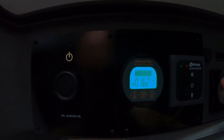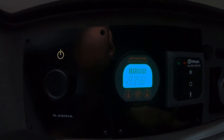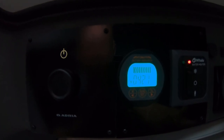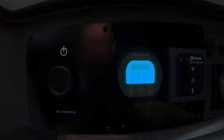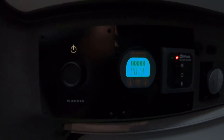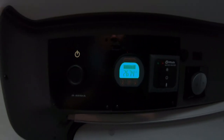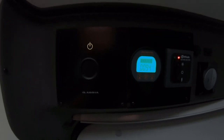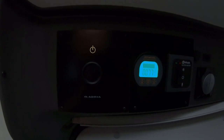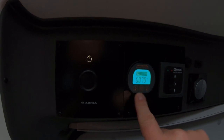If I operate the bed - going up that's pulling eight to nine amps. Going down it doesn't pull much at all - less than 0.6 of an amp. It pulls quite a lot going up because it's got the weight of the bed to lift. So you can see: the bed pulls quite a bit, the fridge pulls quite a bit, TVs and then your lights and everything else. It's quite a good device to see what sort of power your devices are drawing around the van, useful for off-grid planning.